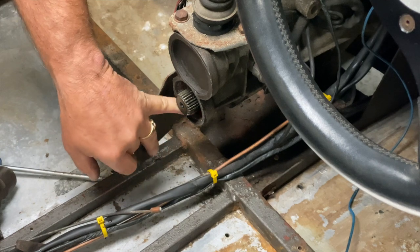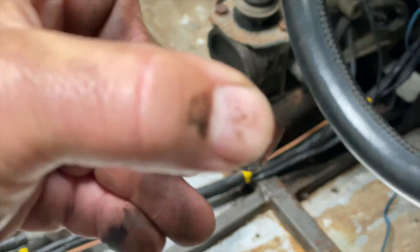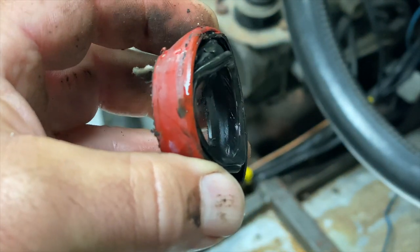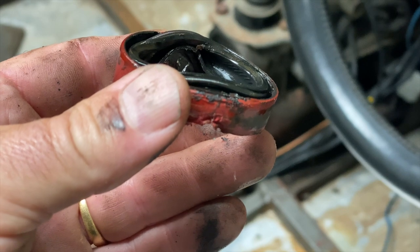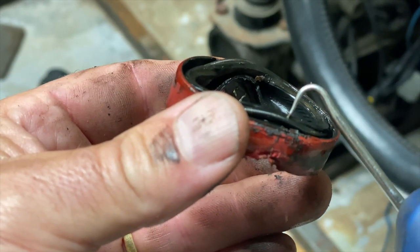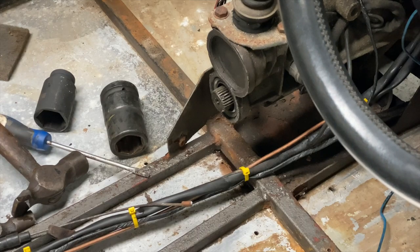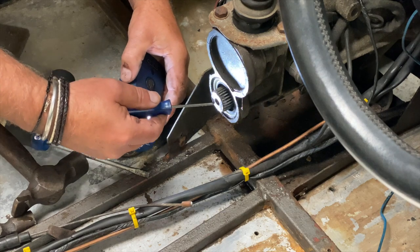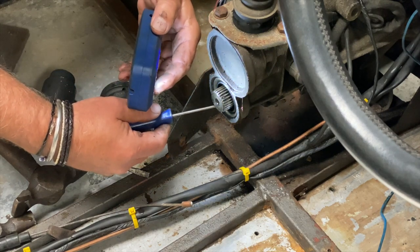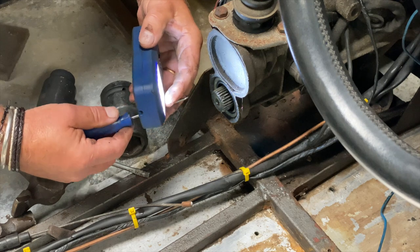What I was doing here was checking the surface I've left behind. Now I want to check the spring is still in the right place on that lip on the seal. If we look at the old one, which was mounted that way in — looking from inside the gearbox, there's a spring there. I'm going to put this probe in and see if I can feel it, having a good look with the torch as well. What I wanted to avoid was hooking the spring out, assuming it is in the groove and fitted correctly — the last thing I want to do is undo the good work I've done.